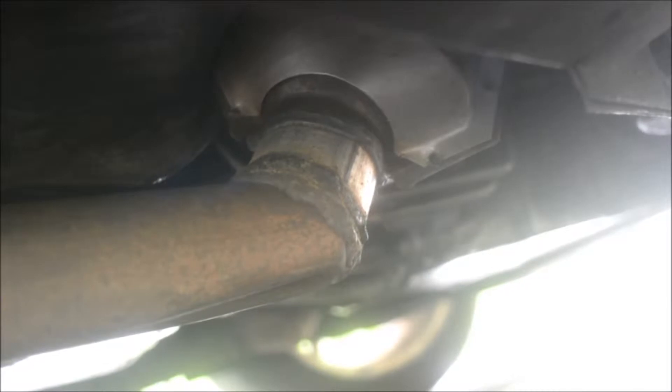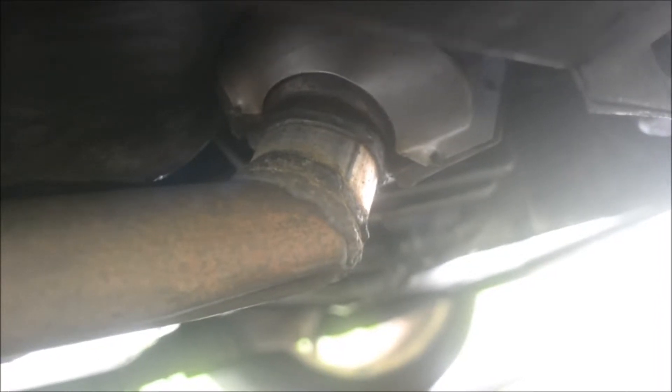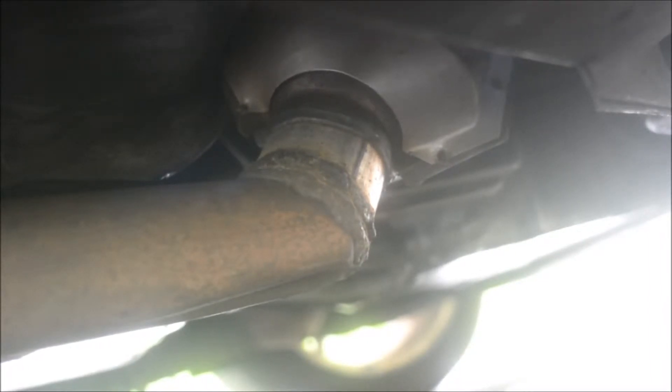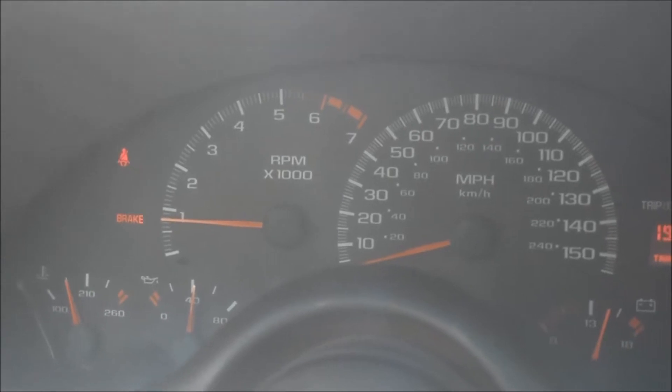There's a new cat — it's a Walker universal, so it has to be welded into place. Maybe later on I'll put a proper cat back on this car, but with the new cat I was able to clear code P0430, which is the passenger side cat. I tried all the tricks and none of them worked — I needed a new cat.